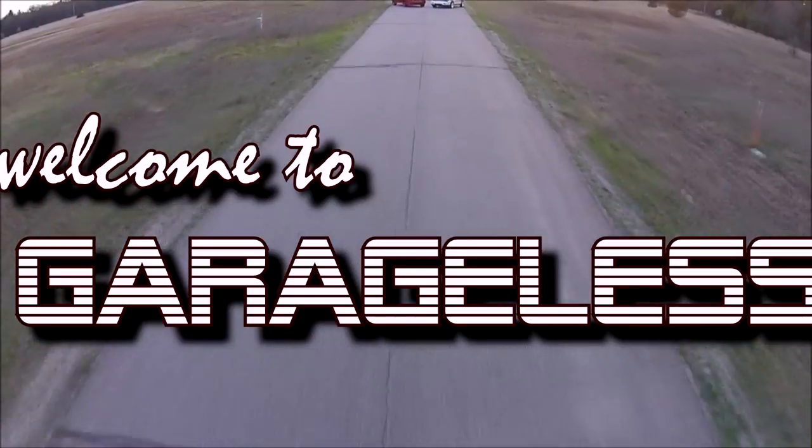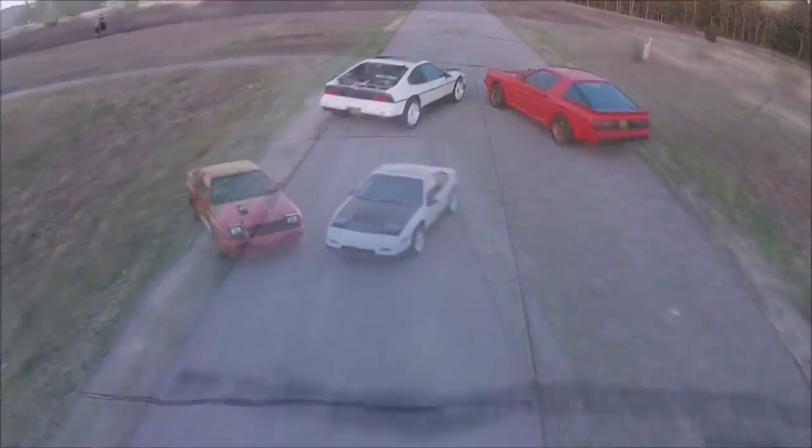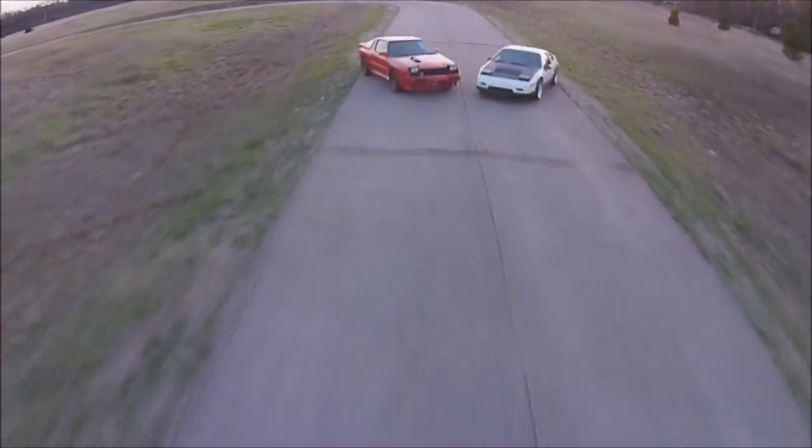Alright, we got a theory to test here. Paul's turbo doesn't spool up until like 5k basically, so he's not hitting full boost until 5k. It went up to 6k when he got to the 9 - so it's taking a long time to spool.